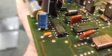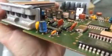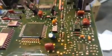Normally this is the one that goes bad for some reason, but this one is actually good. Also look for black fungus, brown fungus, green crusties, or teal crusties — anything on the legs or the bottom of the board that's not bright silver is a problem. The camera doesn't work real great here, but you want to get a really bright light and maybe even a magnifying glass and have a hard look at each one of the three capacitors. Here's the second one, that's in the back by the J3 port.